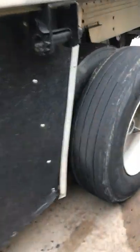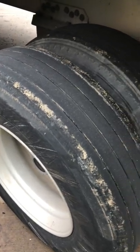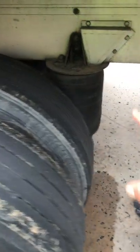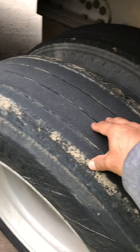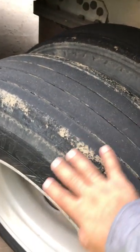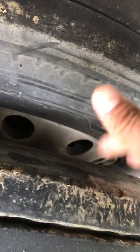You will mention the tires — these are duals. Properly mounted and secure for everything. Tires, no abrasions, bulges, or cuts. Tread depth is 2/32nds of an inch. No bulges on the sidewall or on the tread. There's proper spacing for the dual tires, parallel tires, and there are no objects in the middle.